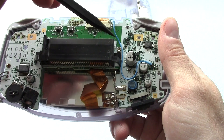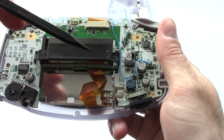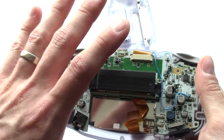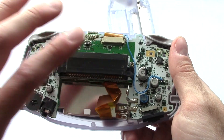Turn it just a little bit at a time and try it out. If that's not good enough, turn it a little more. There also is a point where you can have it turned too much and the screen gets bad again. I've got this thing finally dialed in — it's just a matter of trial and error to get that trim pot set where it needs to be.